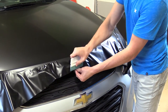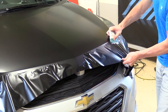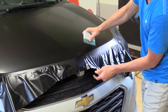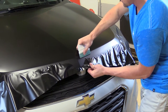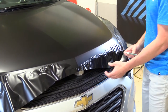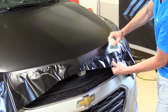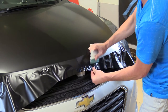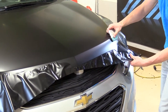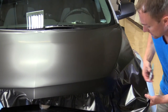You don't want to work all the way down to the edge all the time. Go ahead about halfway down all the way over, then come back — if you go all the way down it's going to create some slack. So stretch this and start working your way down all the way across. By stretching it, it's smooth — if you just card over extra material it would crease the vinyl. The nice thing about a high-quality vehicle wrap vinyl is the adhesive — it's very sticky and tacky and allows you to pop it back up several times and stick it back down without damaging it.